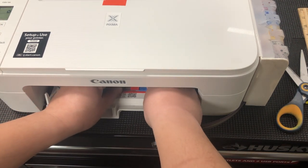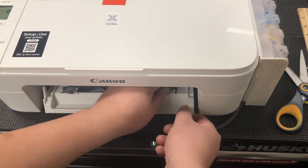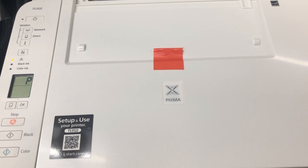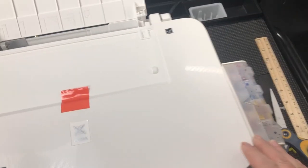Let's say this is a perfect printer, so I'm going to move the cable to the right, make it shorter on the left, and you'll see what happens. That's the P02 error. I believe P03 is when it can't reach the right side of the printer. It depends on where your ink tank is.